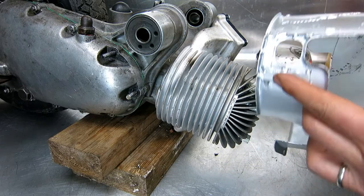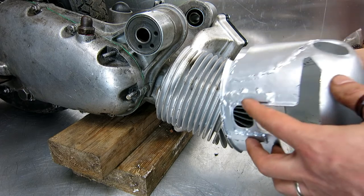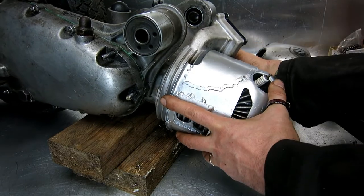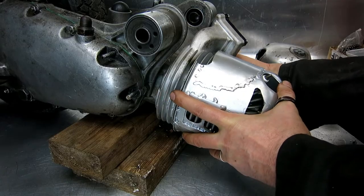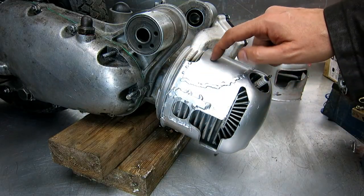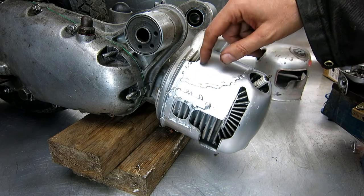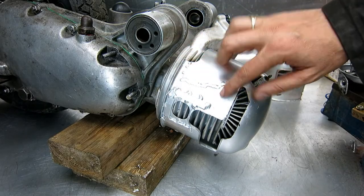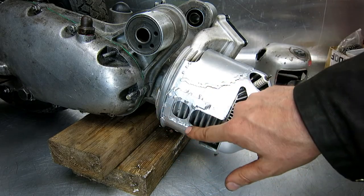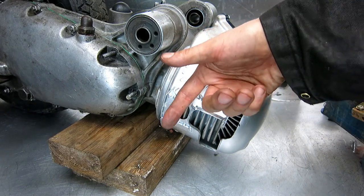This is our half-done and not particularly handsomely modified head cowling that me and my son have been working on. It's designed to be structurally sound as opposed to aesthetically beautiful. I've filled this section here - it's all welded in with a new piece of steel to ensure that the air blown around the fan doesn't escape and runs round. This area here has been reinforced with a welded-on section where these quite often split, and we've cut an extra hole here so that the hot air coming off the fins can actually get out.